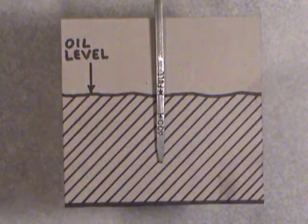Before I forget, I'll tell you now, if you're going to check your engine oil, you always have to wait, especially after you've driven it for a while, because with most engines, the oil pump circulates the oil through the whole engine. So if you check it too quick, a lot of that oil will be in suspension up on top of the valve train and various oil passages and stuff. So you have to wait till the oil actually drains back into the pan.